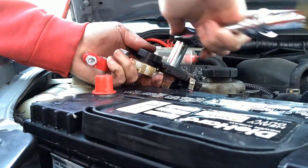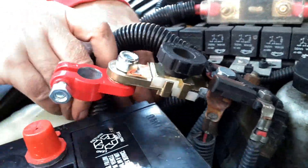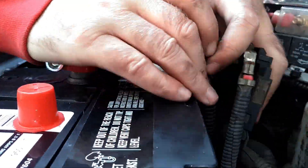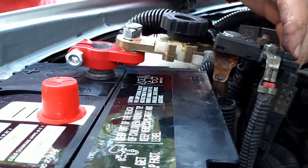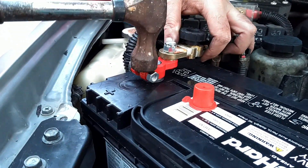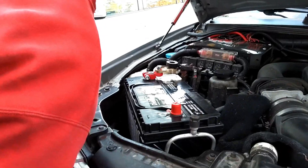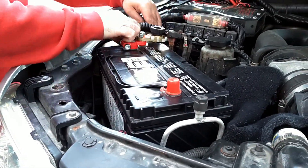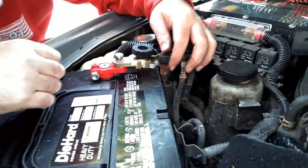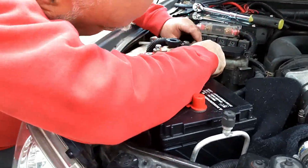The reserve capacity on this is 175 minutes, whereas the original was about 80 to 85 thereabouts. So the battery casing itself is not actually double the size, but some of the ratings are nearly double, which I find kind of interesting. You can see in the video here, which is vastly speeded up because it would be quite boring in real time, just showing how I'm wedging this thing in there. I didn't really super love the way the original came out, so I decided to go back and revamp all the terminals. You'll see that in part two.